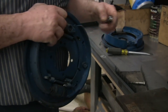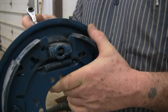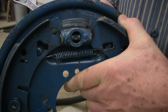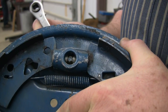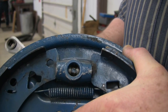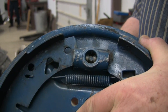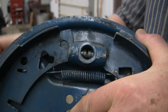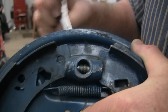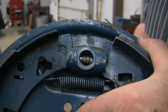Now the adjuster's up here — we're going to come in real close here. Here I've got a quarter-inch socket; this is an air conditioning tool. And I'm going to back this off, and you'll see it turns — if I can hold this thing firm enough. It turns quarter turn by quarter turn, and I'm going to turn it fast. You can see that those cylinders on the inside are now almost touching there. Now the shoes are all the way together, all the way off.